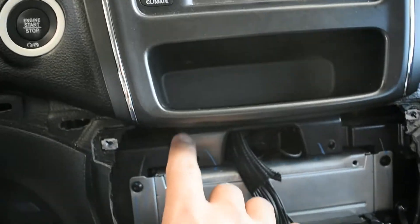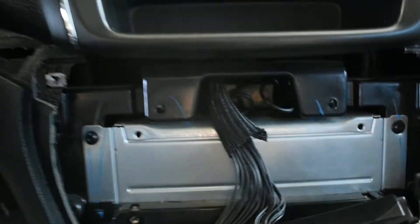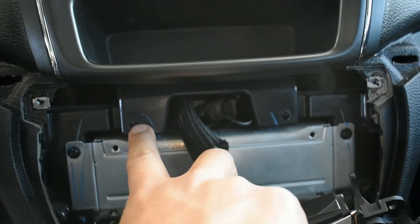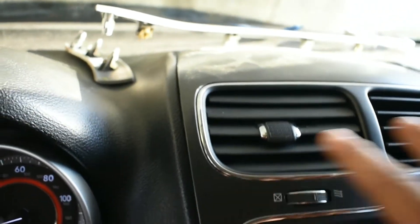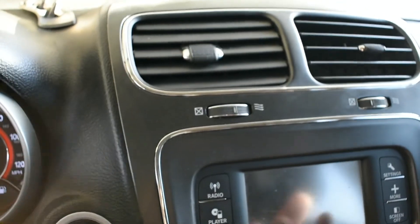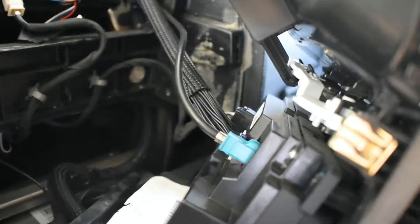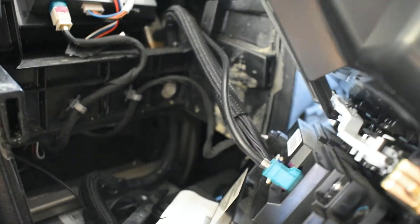To remove this piece right here, you will have two more bolts — one here and one here. This fixture has some clips around it, so just make sure you remove those also with your plastic tool. This should come off. Behind here you will have more connectors — just press the clip and remove them.